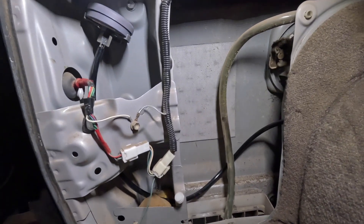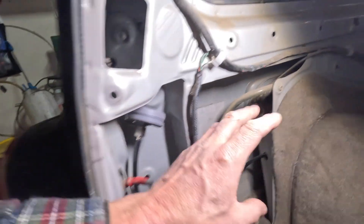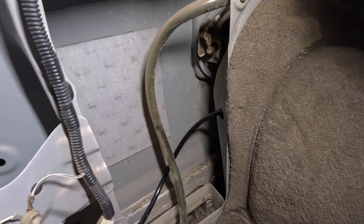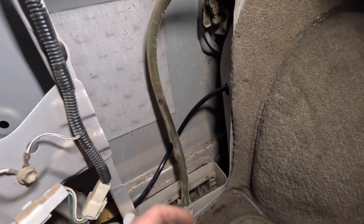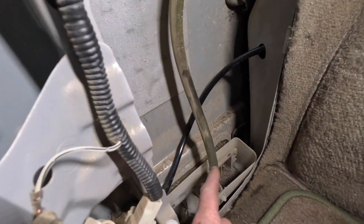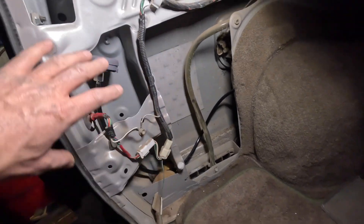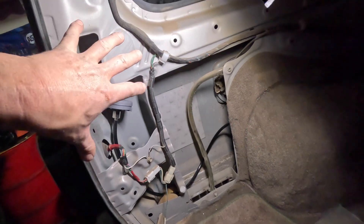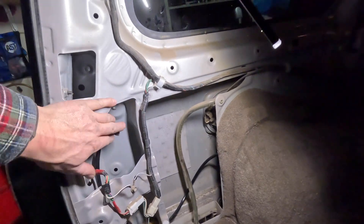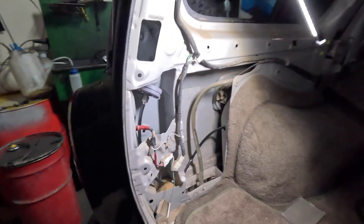I got a really clean, dry spot for the intake of the air compressor. I was just going to put it inside the cargo area, but because I didn't seal up the wheel well very well and there's a cabin vent nearby, I was seeing a lot of sand and water. So I decided to go one further and got it up by the tail light. This will all be covered by the panel so it shouldn't be too loud — nice, clean, dry, and out of the way.